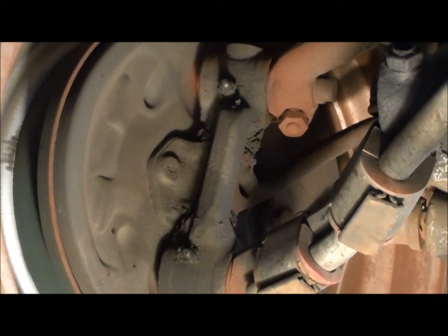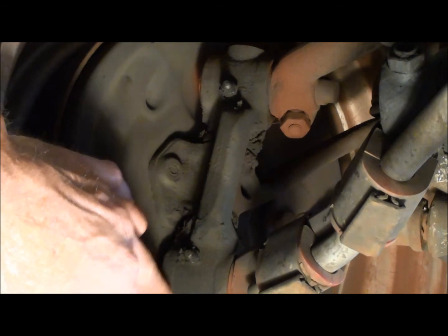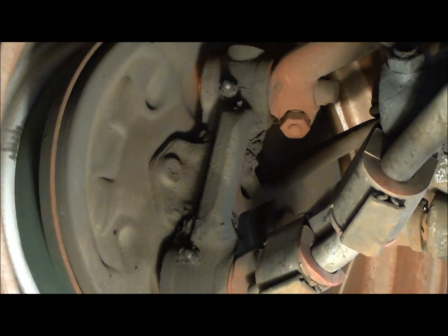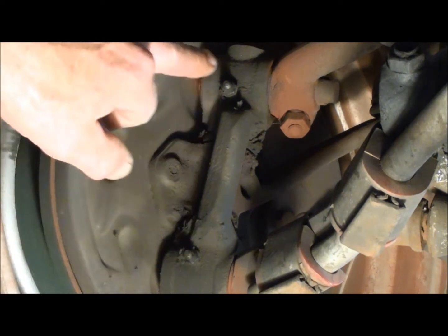Interesting. Okay. Anyway, the king pin runs top to bottom here, and then the link pins come off the trailing arms and go through here with some needle bearings. Generally you've got a couple zerks here to grease it, which greases both the link pin and the bushing that's in here for the king pin. And on the center of the torsion tubes, there's a couple of zerks as well. Anyway, you're supposed to grease these. I don't know how often. I grease them when they get loose. That's just me. But that just means I have to adjust them, or replace them, more often.